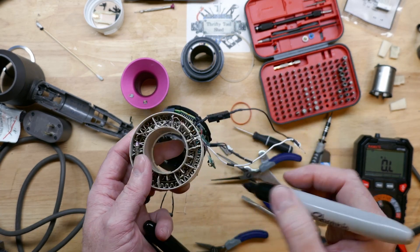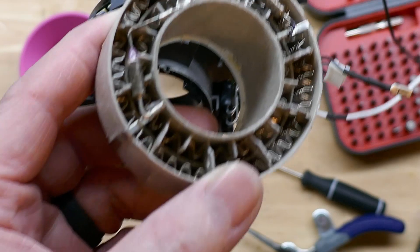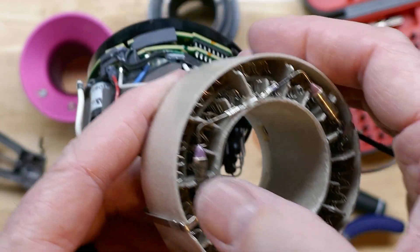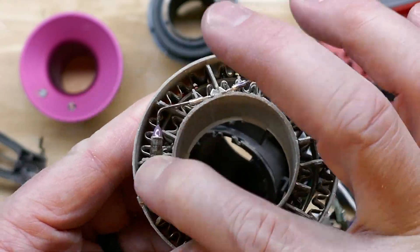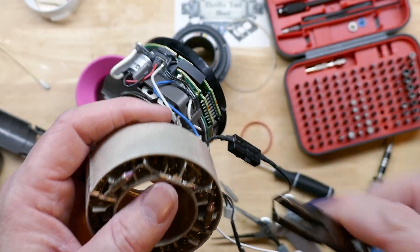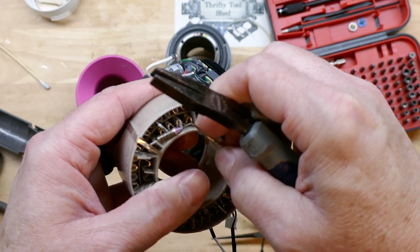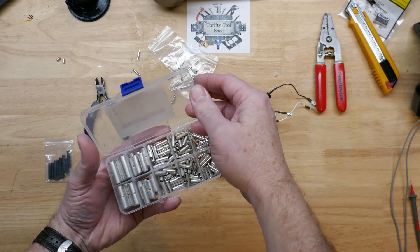Looking a little closer, you can see some discoloration on the top part of the thermal fuse — this one is very bright purple, while the other one has a little more of a brown shade to it. But these are both 184°C rated, and they were presumably both the same color originally.